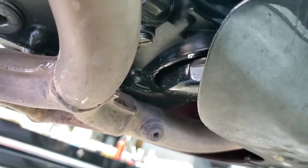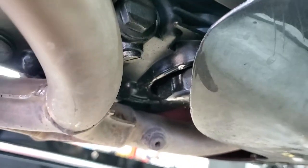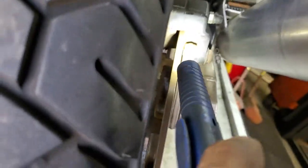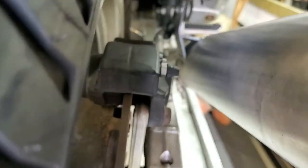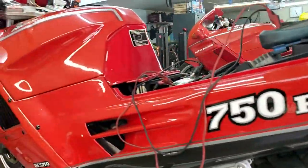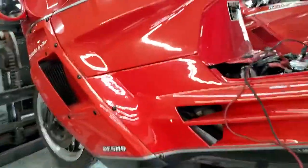So at your discretion — I mean, I know we're doing an oil change, we're going to look into this — but I just want to let you know these have been my findings. I told you how old the tires were. Brake pads, by the way, are wearing very nicely, front and rear. This rear pad has about 30% life left in it. And I told you about the signals and the charging system. That's it, man — I will talk to you later. Thank you.